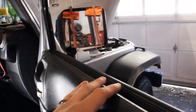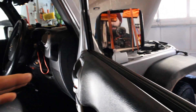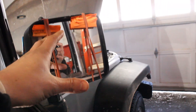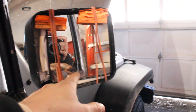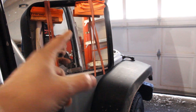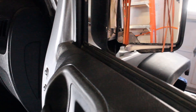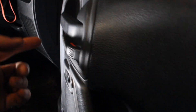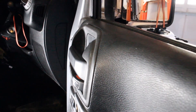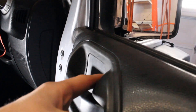One of the first things you're gonna want to do is roll your window down, so you can grab the mirror once you remove the two bolts. He has a heated mirror, so it's a little more difficult than if it wasn't heated, because you have a wire that snakes through the door panel. We actually have to remove the door panel to get the wire disconnected and reconnect the new wire. First you're gonna want to pop off this little panel.